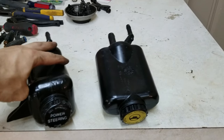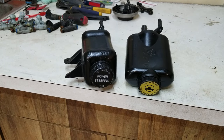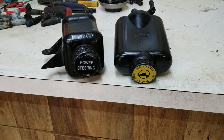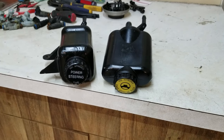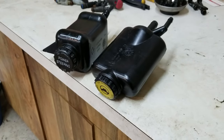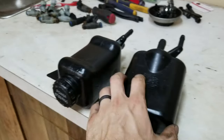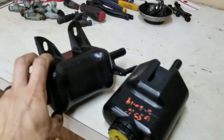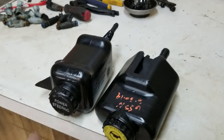These are hard to find because they are off of the four-cylinder Jeeps. The six-cylinder Jeeps had the power steering reservoir actually part of the power steering pump, which was pretty handy. These ones are auxiliary and they actually sit on either the fan shroud — like this one — or up on the radiator itself like this one. This guy mounts so it slides on, and then this one screws into your radiator.